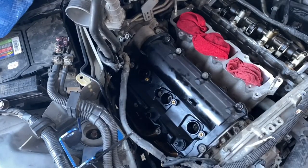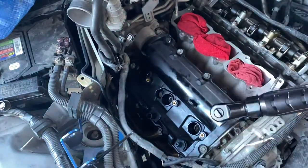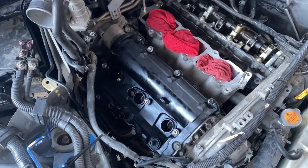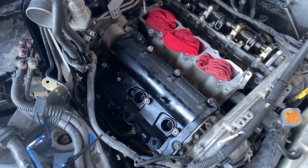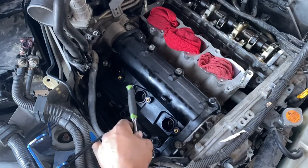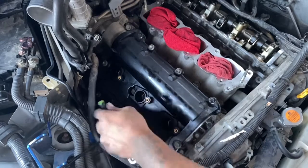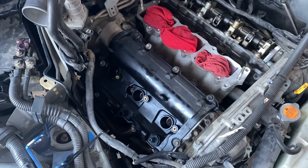Okay, so I don't recommend this, but I'm using a power tool. Okay, so now that I've gotten them tightened down a little bit, like I said, I'm itching for time out here. So now I'm gonna start the sequence over. It tells you to do the sequence 2 times, but I'm doing it in 3 because I don't want to overdo it. I'm down here to number 6. Don't do that. So don't overthink it. When I go over it this time, I'm just gonna literally snug every last one of them, and then we'll move on to the next valve cover.